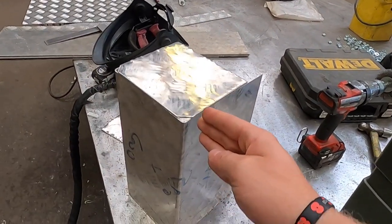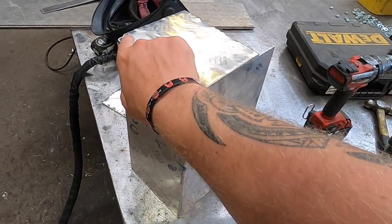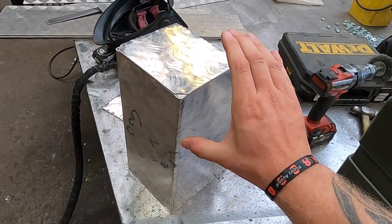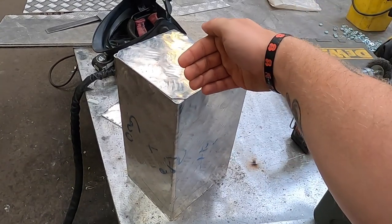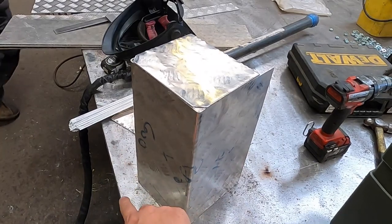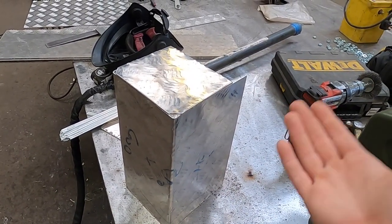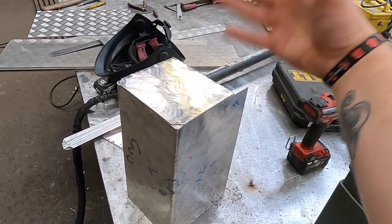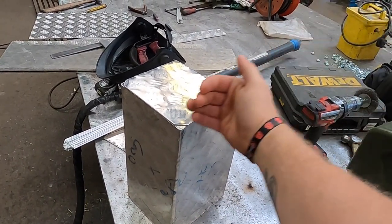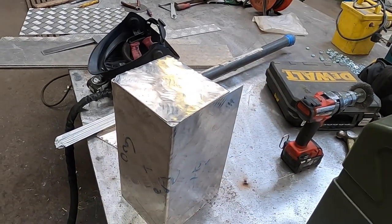What he's just done is nipped off the corners. See this corner? There's a gap there and there because this is going to be upright on the rear of the vehicle, so water would go down and collect. Whereas with these on all four corners, no matter where the vehicle sits, the water can drain off and won't accumulate — because there's nothing worse than scummy road filth building up. Plus when the vehicle's jet-washed, there's an escape for the water.